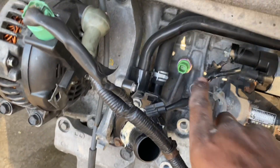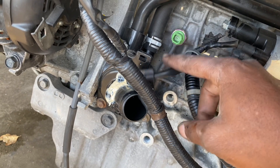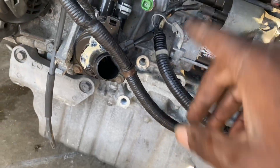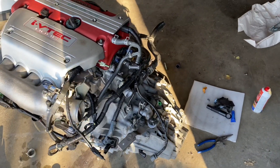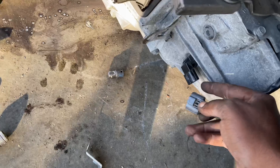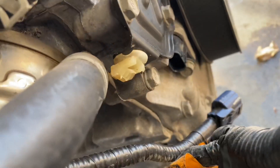The sensor for the knock sensor plug is different — if you're running a base you're going to need a base knock sensor. We'll swap that out later when we're getting ready to start the engine. As far as the plugs they are interchangeable — it's just the knock sensor itself that's different. We got the transmission all tightened back up with the new Action Clutch, all our harnesses are basically plugged in. For the speed sensor plug you want to use the '05–'06 one — I'm going to de-pin this one next video and show you guys how that works. Also since this is kind of a TSX-style motor, the crank sensor is not going to work, so you'll need a K20 crank sensor from an EP3 Si or an RSX.